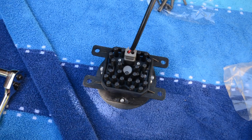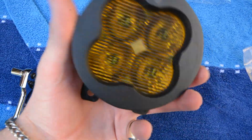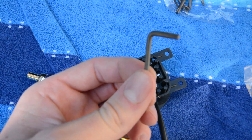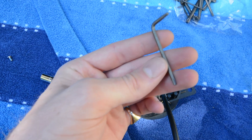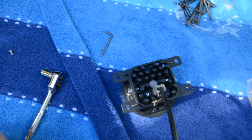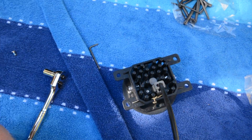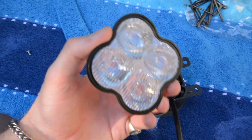Just for peace of mind I wanted to switch these lenses to white so you couldn't really tell they were modified. To remove the lenses from the fogs there are four screws around the bezel. Forgive me — the allen keys you're going to use to pull off the screws, they almost look like a torx bit. I can't remember if they're SAE or metric, but these are from a Husky allen key set and they are definitely like a weird little star pattern. I'll put a link in the description as to what these are.